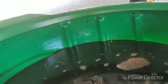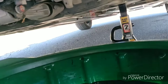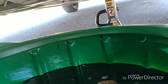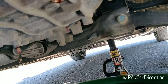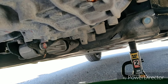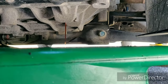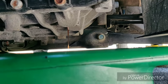So let it drain. After you bust it out, let it drain for a bit. You're supposed to be doing this on level ground or on a lift, so I'm going to have to leave this pan here, take the car off the jack stand, let it sit flat, and drain some more. Then we're going to measure what we collect and refill the transmission with that amount plus about 0.2 of a quart.